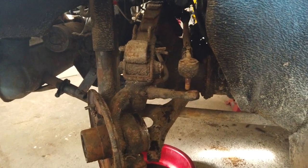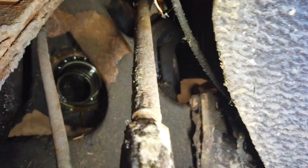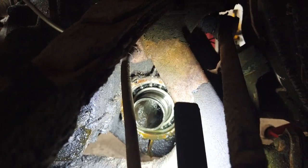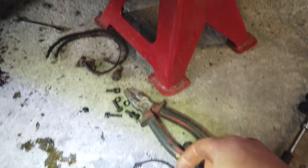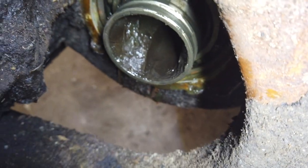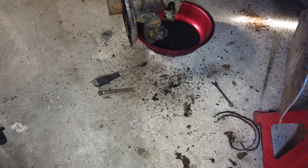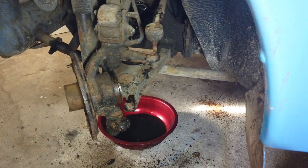I ended up getting into some troubles - not big troubles but some troubles. I realized I did not have to take that thing out with the four bolts, so I will have to put that back in and make sure it's leak free. The way the rubber is held onto the gearbox is by this little rubber spring clip - that is broken so I can't reuse that. Maybe you can see a groove in that cup - that is where the rubber is supposed to clamp onto. So I don't have to remove that part. That actually means it's not necessary to drain the oil on a Trabant to change the driveshaft - good to know. But take a look at the oil - I'm really happy that I'm doing it anyway because it's completely black.